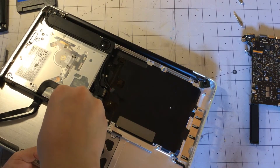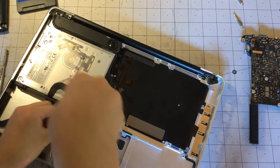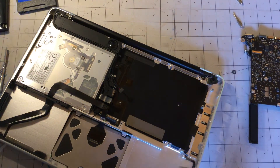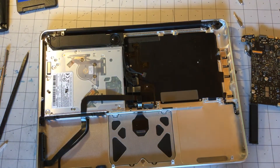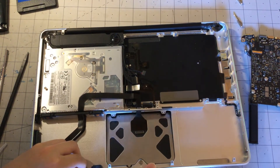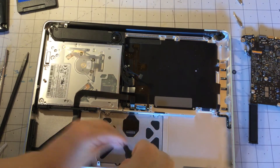We are just going to remove this one last screw for the trackpad. Now with those screws removed, we can remove one last piece — not really a screw, but some sort of thing which helps the trackpad click. We can just get the right bit and unscrew that. Look at that — the trackpad is about to fall out. There we go, there's that little shield thing.